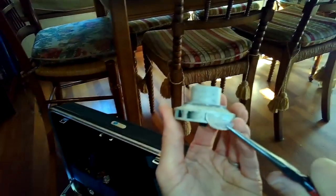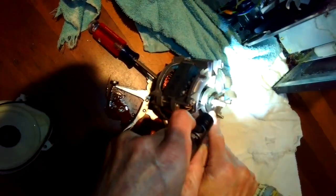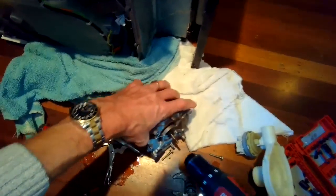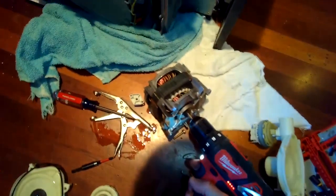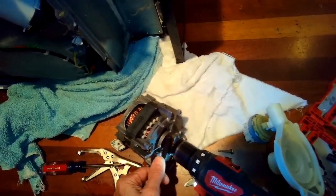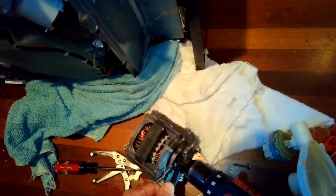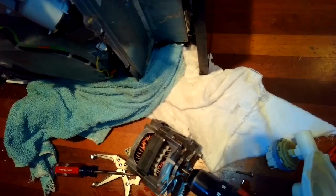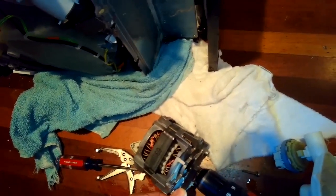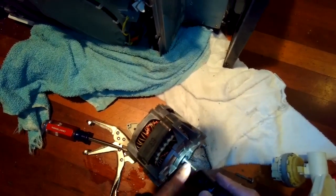It's a little piece of plastic — looks like a piece of Tupperware got sucked into the impeller vane. I just pulled that out. Now the best thing is to put a new partition kit in. You can get them from Miele USA online; they're pretty cheap. I'm taking the corrosion off the motor shaft by putting the shaft in my drill and using a wire brush to remove it as I spin it — it just has a little bit of rust and corrosion that builds up, which usually points toward the partition seal leaking. I got all that off.